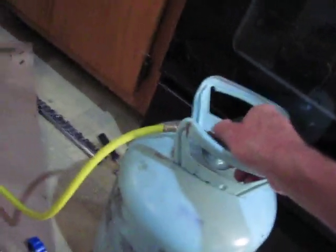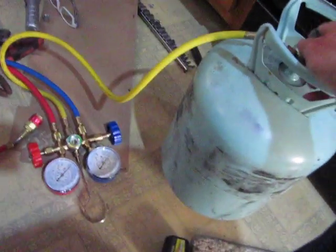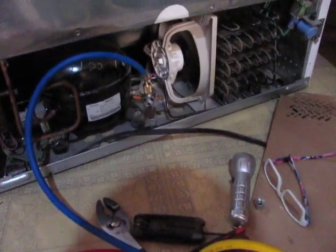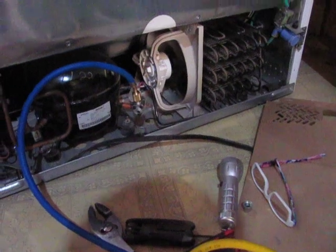What I want to see here — do you see that zero? That's where I'm at. You want to see zero degrees; minus one is good, minus two is good. This refrigerator — I could give it a little bit extra and I probably will. Just one last little shot. I'm not going to keep playing because there comes a point when you've overfilled it and that makes it inefficient again.